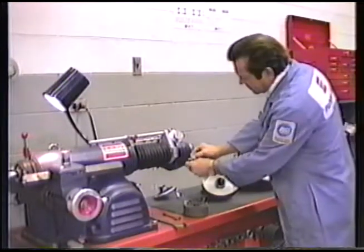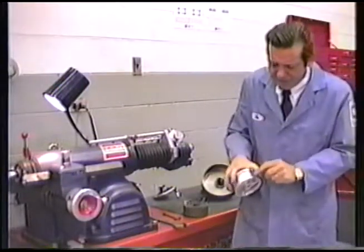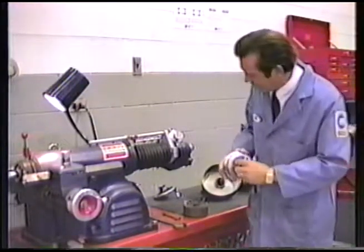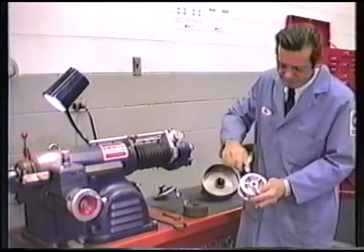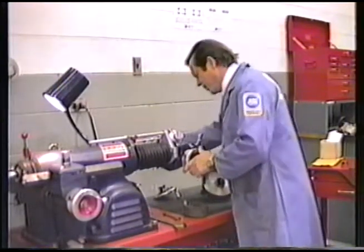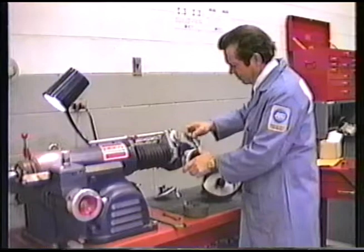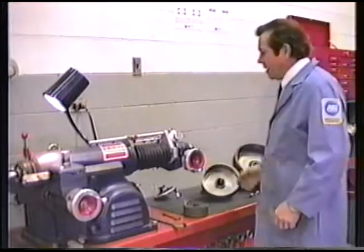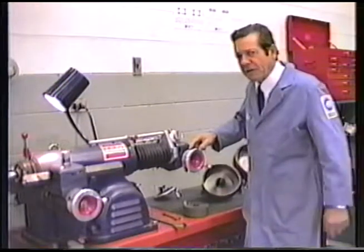There's a spring washer that slides on next. Then, all we have to do is line this hole up with this hole. That will allow us to access the threaded hole which the original Allen screw fits in. We'll slide the new hand wheel on, compress the washer to give it a friction fit. Tighten it up. Now we will be able to advance the spindle, and you will be able to keep track of how many thousandths you're taking off the face of the brake drum.